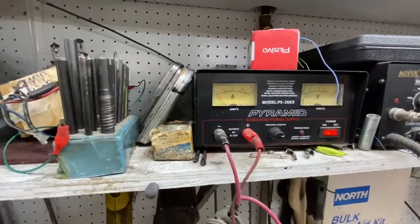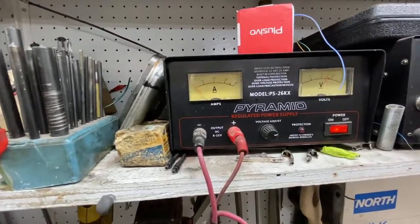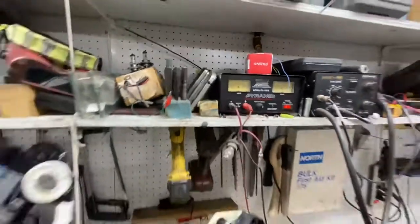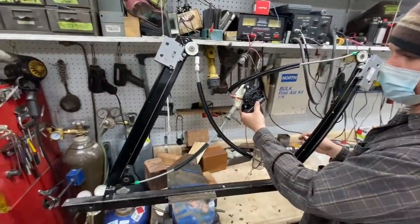You have to reverse so that we can see the amperage draw on it — so we're going to go up again. The amperage draw is minimal. Well, it's up there at 9 amps, but that's not unusual for a DC motor on a window to pull.